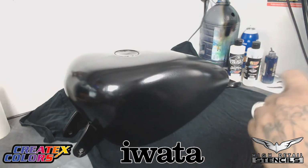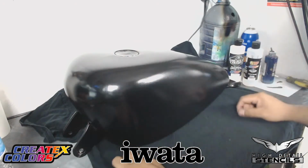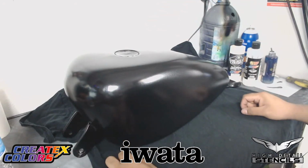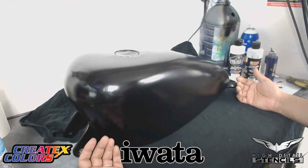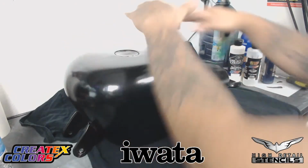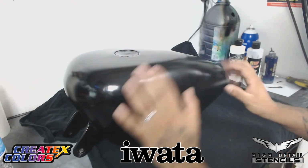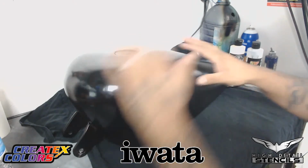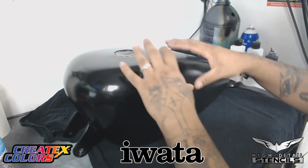We got it all sanded up, primed it with some sealer, sanded it again, and laid this nice black base coat. It's metallic, pearly. The customer requested skulls all over it, but he also wants chameleon paint, so he wants the skulls to look ghosted in. The way we're going to achieve that is to lay the skulls in white all down in here, not too bright, just kind of hazy.